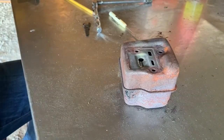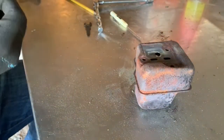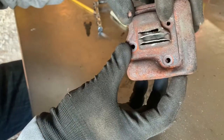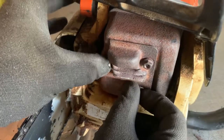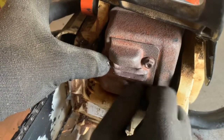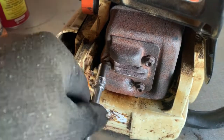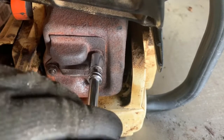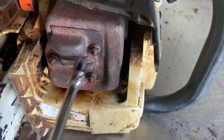I'm just looking at how the overlap is going to fit together. If I keep my screen, I should be able to line it up with my new face and what I'll be left with is a much better breathing saw. Now I'm just putting the muffler and screen back in place, making sure I have my keeper washers. Again, I'm using a 5/16 screwdriver. Nothing too crazy.